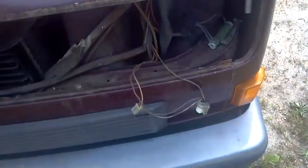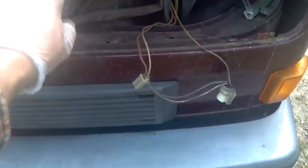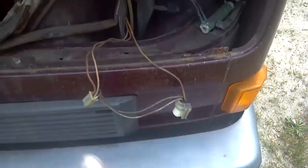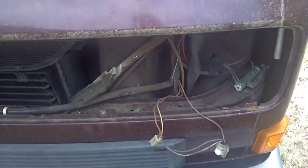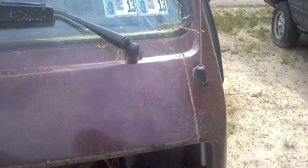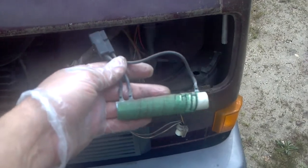It's not a big deal to do. I've already pulled the headlight out — you just take out the whole frame and everything. There are four little Phillips head screw holes here; take them loose, unplug it. Check to see if all your lights are good before you do that, because that would be a great time to change out your headlight bulbs if you need a new bulb. It would also be a great time to change an antenna if you have a broken antenna. But if those things are good, all you want to do is change out this resistor.